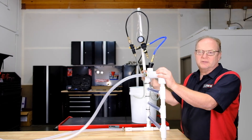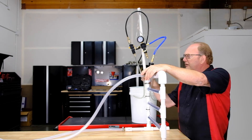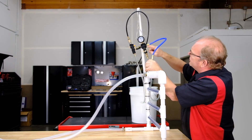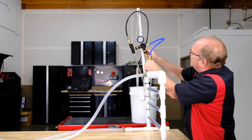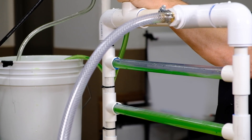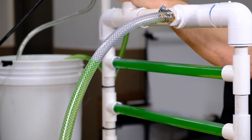We've moved to a simple model of the cooling system so we can really see what's going on. Here we have our radiator, and in the back there we have a heater core for rear climate control. Systems like this are really hard to get the air out, so by using this kind of tool you can really make a difference. As you can see, we're pulling our vacuum. The vacuum is drawing the fluid into the system. Now we'll go ahead and start the fill.